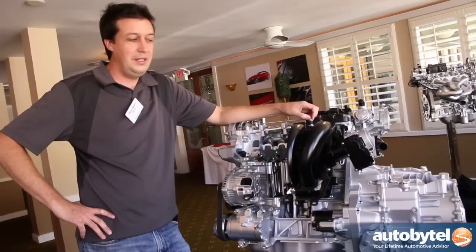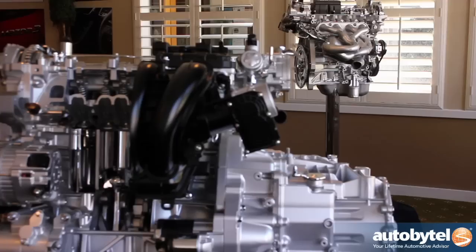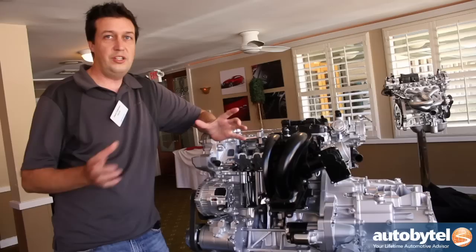Just putting this manifold on here let us push the compression ratio from 12-to-1 to 13-to-1, and it got us quite a big boost in torque and fuel efficiency. Another very unusual feature of the Mazda 3 that you'd probably never notice unless I told you about it is the way we make our 2.0-liter and 2.5-liter engines. They're both exactly the same design, but the 2.5-liter is just scaled up proportionally from the 2.0-liter.